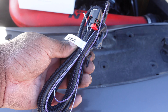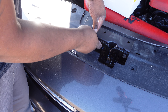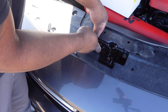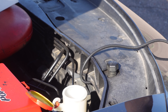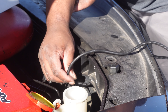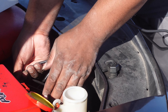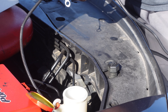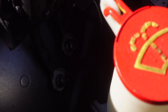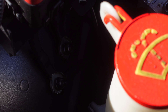The next part is hooking up your wire harness, so we're going to take our connector and get it ready to be plugged in. The connector is plugged in. As you can see, I ran the wire underneath this piece, ran it through a hole, and you pull it out through here — be very gentle as you're wiring this. Now we're going to take this ground and show you guys where to hook it up. These two grounds you see by your fuse holder — you're going to take a 10 millimeter and unbolt it to tie down the ground.